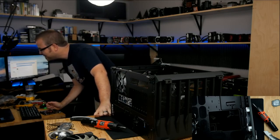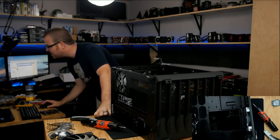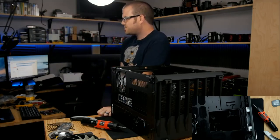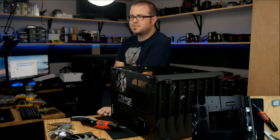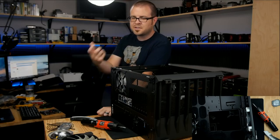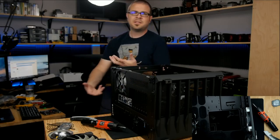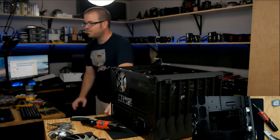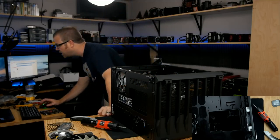All right. Nico Bowling says, thank you for your donation. One of the bearings on his MSI Gaming 980's fans is gone. That's a good question. Can you repair it? Repairing it might be difficult. Repairing a bearing fan is very challenging, especially a smaller one. I would contact MSI about that. There's a good chance you're still under warranty. If you talk to the right people in support, you might be able to get them to send you a replacement fan that you can install yourself, but you might need to just RMA it and turn it back in. If the fan is failing due to a bearing in it, that should definitely be covered by warranty.